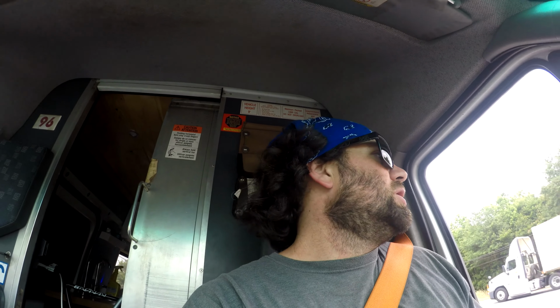So with all of my electrical stuff that I have in here now, I tested it last night. I ran everything. I ran my lights as long as I would typically run them for a night. I ran both of my fans on high all night. I had left my refrigerator running. I left my TV on. I left the radio on. Well, with 4 batteries, it kills my battery bank in about 24 hours from full. So that being said, the solar panels do not charge this thing fast enough.